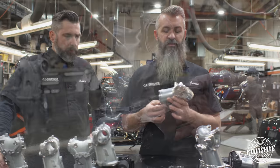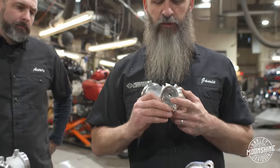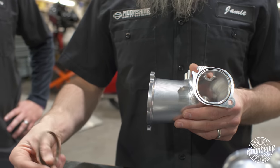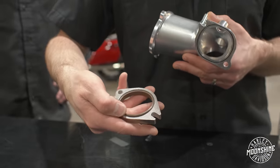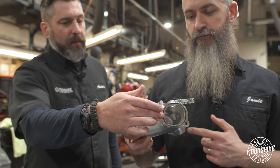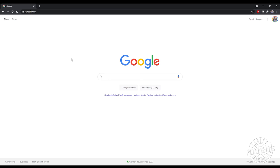The flanges on this have a brand new port design. The guys that helped us design it were Frankenstein Engine Dynamics — they came up with a brand new double o-ring flange, just a nicer quality piece that seals the intake to the head. The stock Harley one uses an angled seal that as it presses toward the head it flares out; this one is more streamlined so you don't have to worry about it being pinched or impeding the port. When you look up inside the port mounted on the bike, the match to the cylinder head is absolutely seamless — a really beautiful port match.